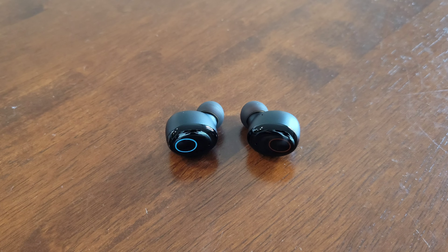When the indicator light on each of the earbuds is flashing red and blue alternately, the earbuds are trying to connect to each other. And once the earbuds are connected to each other, only one of the indicator lights on one of the earbuds should flash red and blue alternately. So these earbuds are turned off — I'm going to turn these earbuds on now.